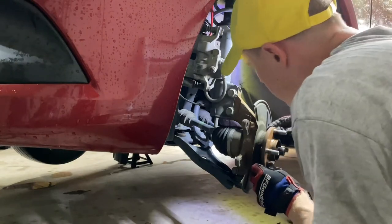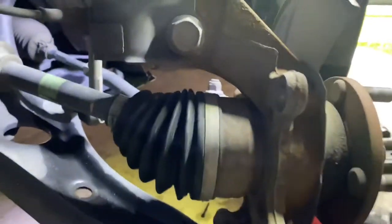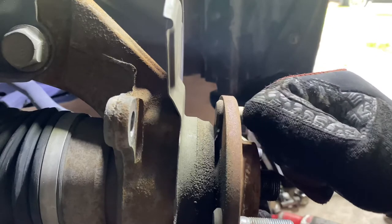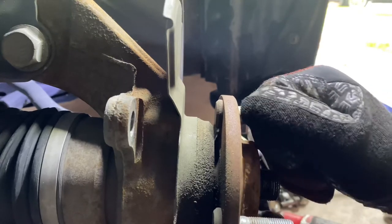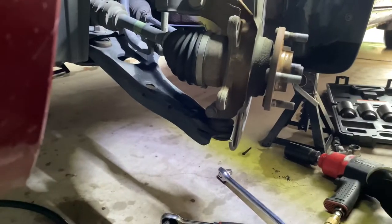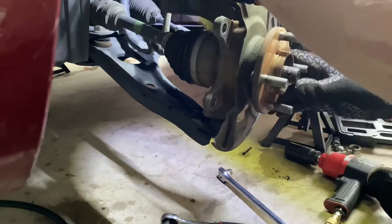I don't know if you can see that — let me get you closer and tilt down. Hopefully you can see, maybe even hear the movement. It's raining right now so not sure what you'll see or hear, but there is some play here that should not be here. When you're driving down the road you can sway the car back and forth — the sound goes away when you sway one way and gets louder the other way. That's very typical of a front wheel bearing going bad.